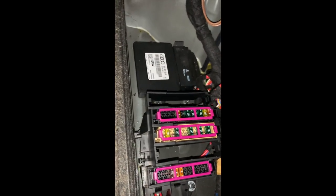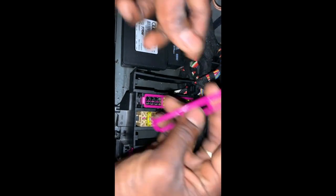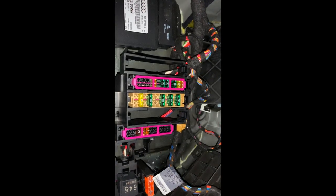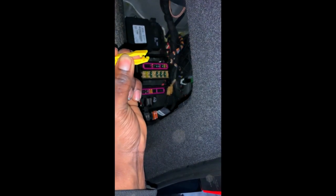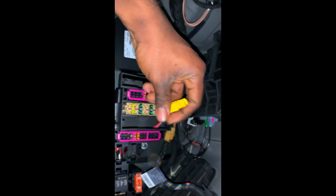There's a little area where you can pop out the clip, so you want to get your hands in between and pop it out just like that. You don't want to go too hard so you don't break the clip. Inside the emergency fuse kit they have this long yellow clip remover — you're going to grab that, which is what we'll use to remove the fuse. Hold it like chopsticks or tweezers, come in a little bit, and clip onto it.